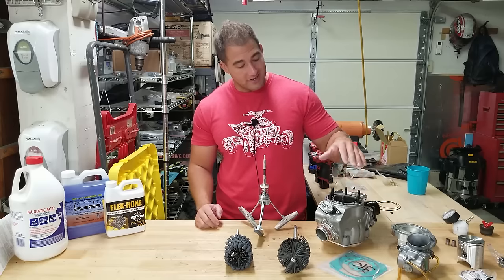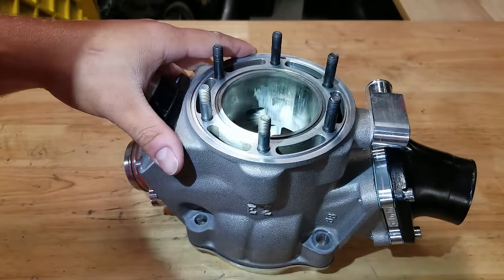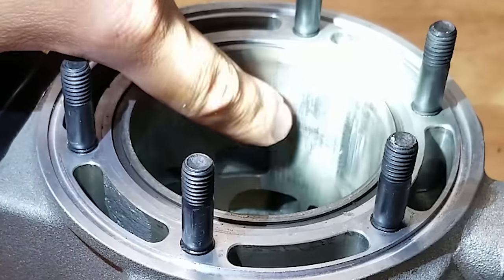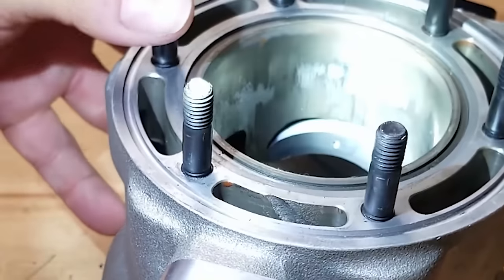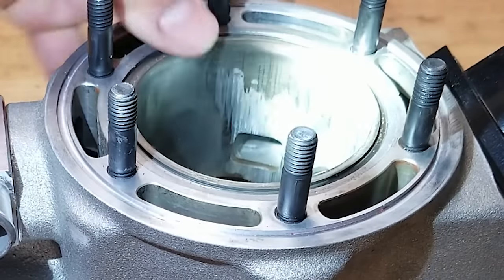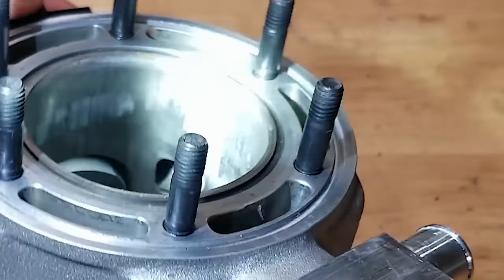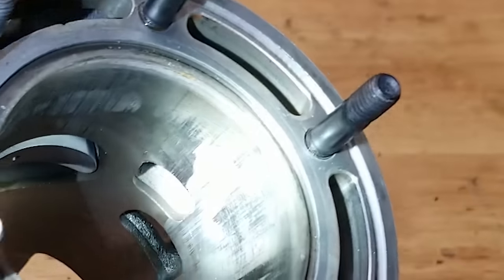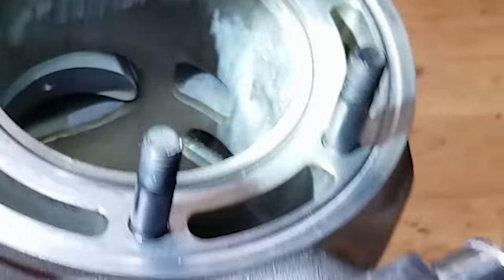Let's get into cleaning the cylinder. First, we're going to remove the piston transfer using muriatic acid. Here's what piston transfer looks like inside the cylinder — it's a slightly different color because it's actually aluminum deposited on the walls. There's a bit in the front and some on the side — that worst spot you can actually feel is raised up. A lot of people questioned the condition of this cylinder, but if you look closely you can actually still see the cross hatching underneath the transfer, so this cylinder really isn't in bad shape.